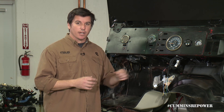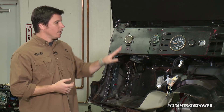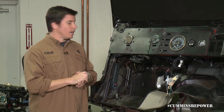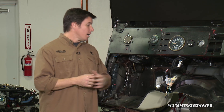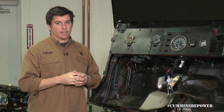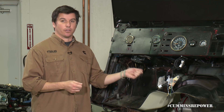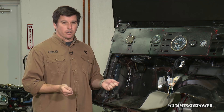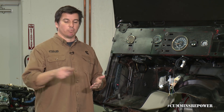These are all speaking on that J1939 and J1979 CAN network. So if you're looking for throttle position for some other device, get it from somewhere else on our wiring harness — we have several points you can pick that up without cutting into the harness. If you want to make sure all those messages are being broadcast correctly, you have two terminating resistors on that wiring harness: one is near the Murphy gauge — you'll see a little gray plug — and the other is on the opposite end near the ECM. Don't take out those terminating resistors because they help complete that circuit.